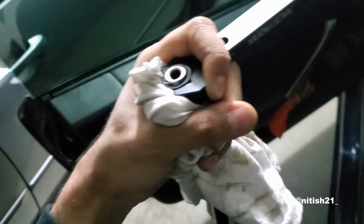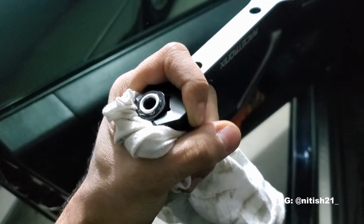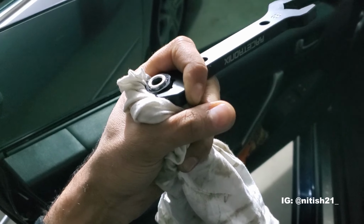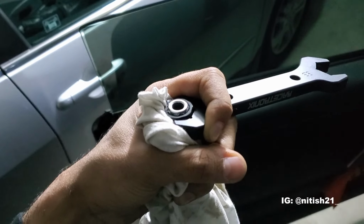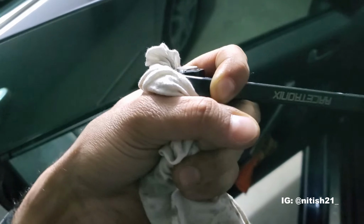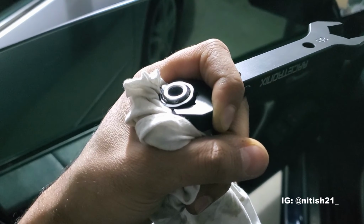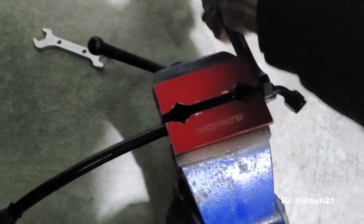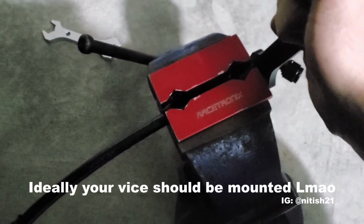So one way I have a little technique to do this is I just grab it with a rag from underneath, grab it quite tight, put the wrench through my fingers, and then I grab the rest of the hose with my right hand, and then I twist and pull the hose down. What happens is the hose drops with the actual metal fitting inside, but the outer layer rises up, until I pull it through a little bit more until it kind of levels out, and then we will put it in the vise. You can see how easy this is once you have a vise on it and the thing's in there, you just crank that. It does get a little hard near the end, and then worst case, you just put the rag in between, like I showed you. Like right now, it's going to get a little harder to do it.